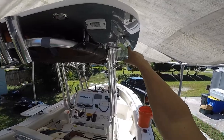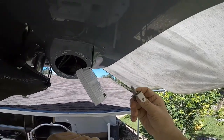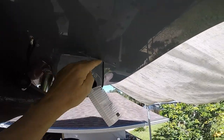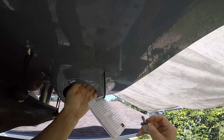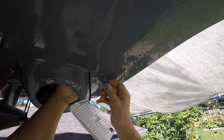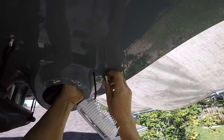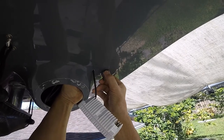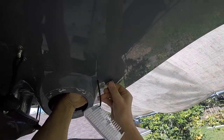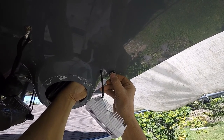This is the bracket - I drilled the hole here and chamfered it so it doesn't crack. Same thing with the hole for the wire. I have a backing plate up here behind it because with these lights they might have a tendency to bounce a little bit and I don't want to crack the hardtop. So I put a backing plate, there's a washer, then I have an elastic stop nut on top of it.